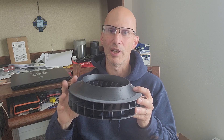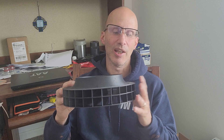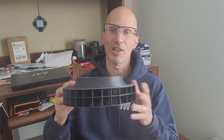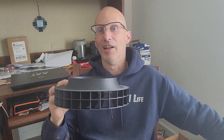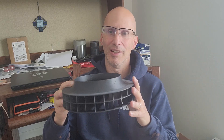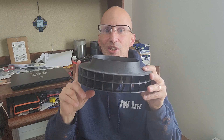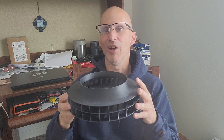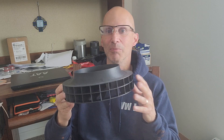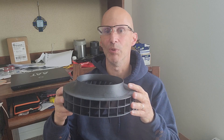So I don't have to raise the prices on these, which is great, but you just get a more bulletproof, stronger fan. I don't even know what the RPM limit is anymore — that's a common question. Obviously I tested to 8,000 and it passed just fine, even with the old material. With this material, with a 92% increase in strength in the Z direction, I don't know that there's a Type 1 engine around that can rev high enough to blow this thing apart.